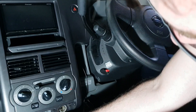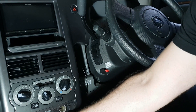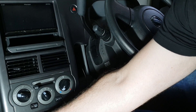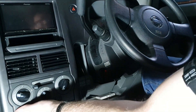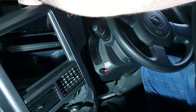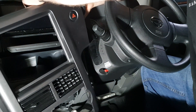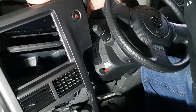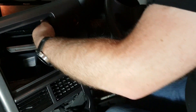If you haven't seen how to get this out, you can definitely check out the install videos from when we installed the stereo. If you don't want to do that, it's really simple — just pull the ashtray out, there's two screws at the bottom that need to come out, and then this just pulls straight off. There's a little clip for the hazard lights up here which just needs to be pushed in. I can never actually manage to do it properly — I'll just grab a flathead screwdriver for that.